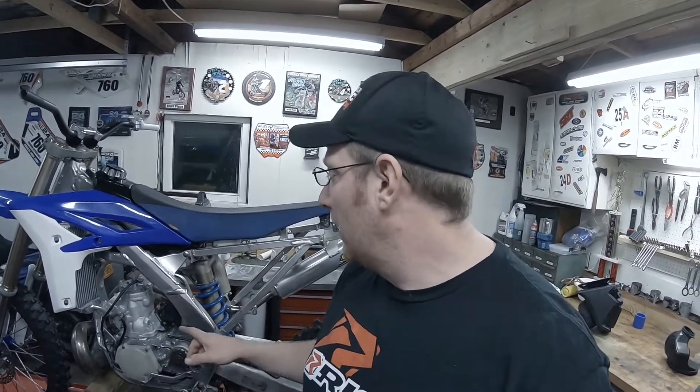Project Frank Ripper is back on the stand, finally. Last episode I was cleaning the carb on it because I'm going to be putting the carb on it, obviously, and trying to fit the four-stroke airbox to the two-stroke carburetor. It's a little bit more difficult than you would think because the boots are different — well, let's just face it, it's a totally different motor.